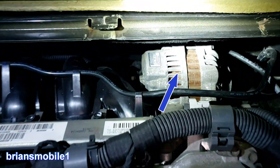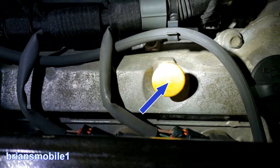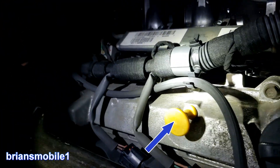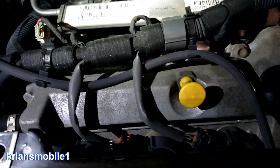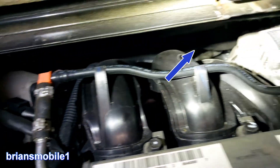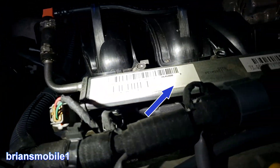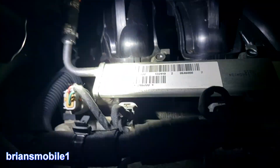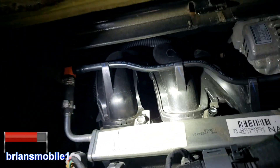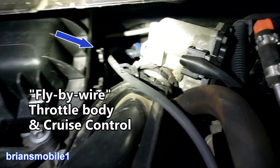You can see the alternator here. This is where you fill the oil, this is where you check the oil — that's your dipstick right there, usually indicated in yellow. This is your fuel injector line, here's where the fuel pump fuel comes in, across the top of the intake manifold, then goes to your fuel rail, and then you've got your injectors underneath. It looks like this is a three-cylinder one-liter. This is your throttle body.